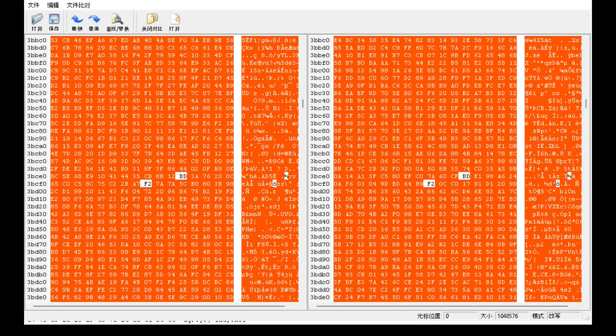So what we've got to do is just make space on the screen here. What I've got to do is just drop the program on the other one. Right, so what we've got now is J, which is the original, and then we've got E, which was off a faulty board, but it's not the Southbridge board, it's faulty. So what I'm about to do is to load J into E's NOR.